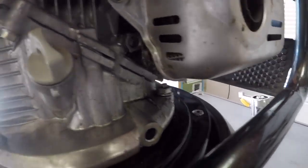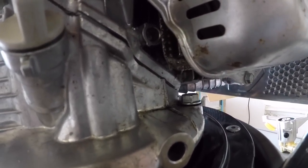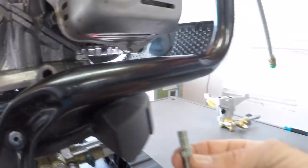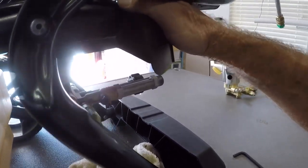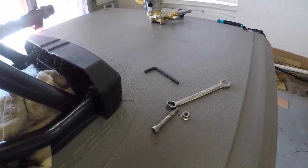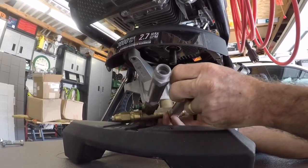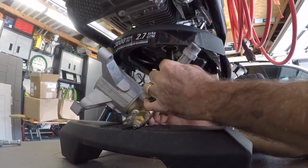We'll do this for all three of the mounting bolts. Once you've removed all three, the only thing holding the pump to the motor itself is its own friction. Sometimes they might be stuck a little bit and you might have to tap them or shake them left and right, but this one seems to be loose already. We're going to go ahead and remove it, drop it down, and that is it — the pump is now separated from the engine assembly.